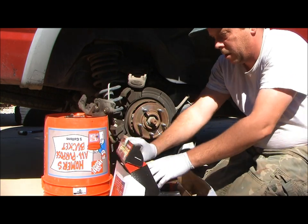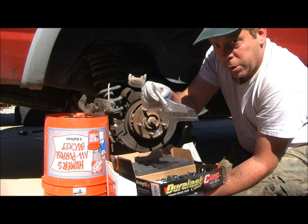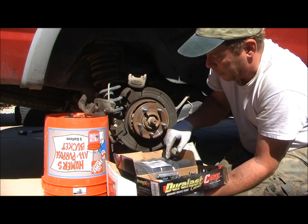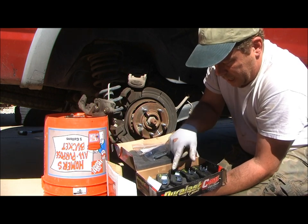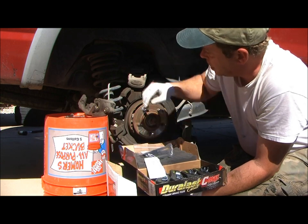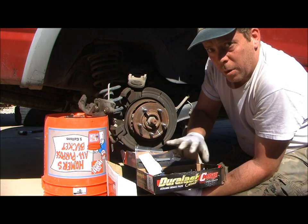Here we've got a fresh set of brake pads. In a brake pad kit, you get these two retaining springs — they actually go right here and right here. You get them off by just putting a screwdriver behind them and giving it a little tap, then you can press the new ones into place. You have the inner brake pad and the outer brake pad. And then you've got contact grease. The grease goes on the back of the pads and it's used to cut down on squeaks that come off the caliper itself. Never put it on the front of the pad because that will get on your rotor and then you won't stop.